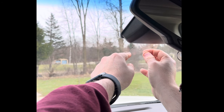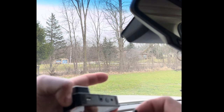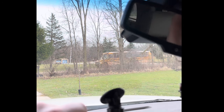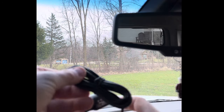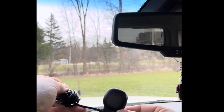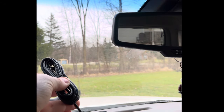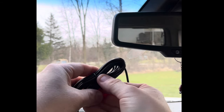I'm going to guess it's going to go somewhere in that vicinity. The screw mount for this guy is on the top of the camera. Tighten that down nice and then we need to figure out a good angle so I can see out my mirror and see the camera without obstructing my view. The camera module plugs in right here and then it's got a GPS receiver right here on the same line — make sure that this also has a good line of sight to the satellite or you're not going to get a GPS signal for your recording.